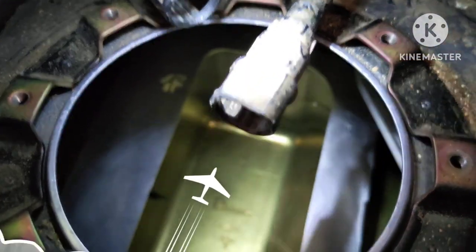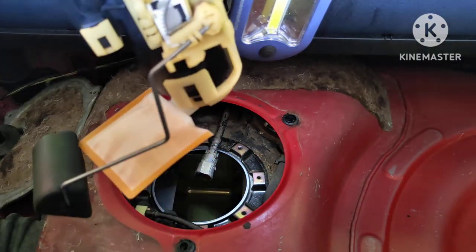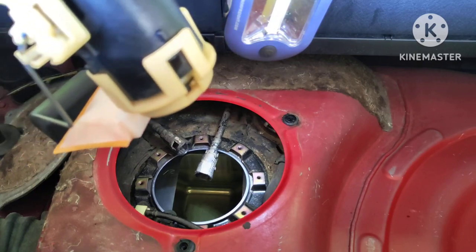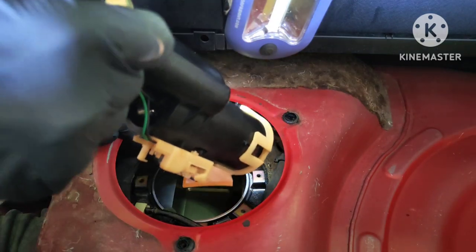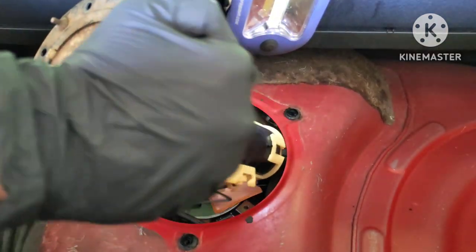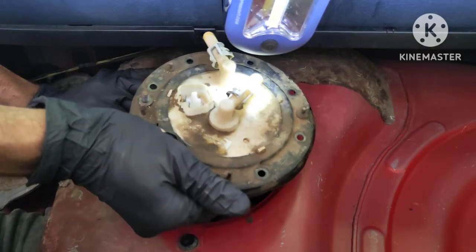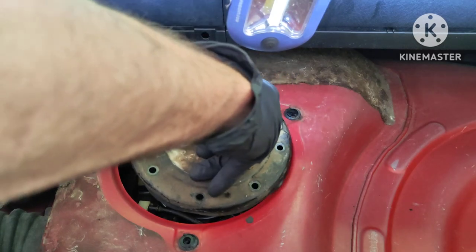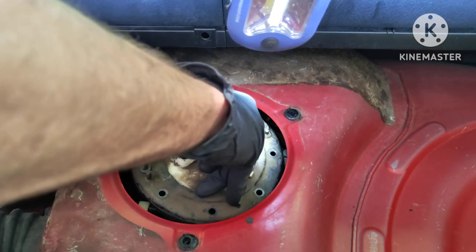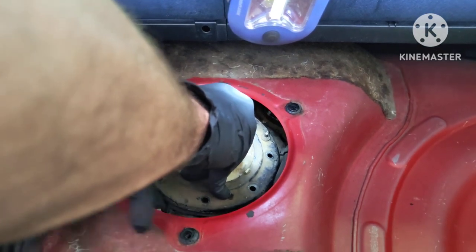Here's your fuel pump — make sure you're careful with the leveler because you don't want to bend them. Watch your fuel lines, bend them out. You kind of have to go at an angle and you want to make sure you get it inside the baffle. Just drop it down slowly — you're gonna have a bunch of lines in the way which you'll just have to work around, mostly just your fuel line.